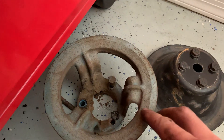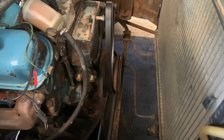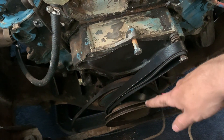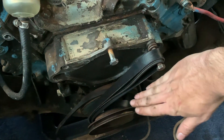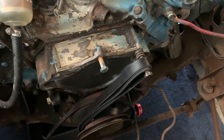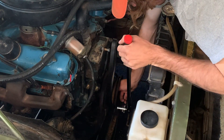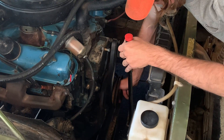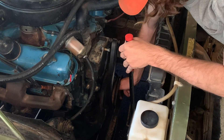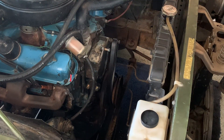The crank pulley is held in place with six bolts, three of which were retaining the aftermarket pulley. Before undoing the final three bolts, I needed to use the pulley itself as leverage against the rotation of the motor to undo the crank bolt. I initially tried using the V-tooth belt on the wagon, but it was too thin and couldn't hold tight enough. Thankfully I remembered I had a spare serpentine belt in the trunk of my Mustang — its length and width allowed enough tension to undo the bolt. If you don't have any power or pneumatic tools, you can use a rubber belt: pinch the belt in on itself between two points, the other point being a bolt put back into the upper timing chain cover, and turning the crank bolt with a breaker bar will provide all the tension needed.